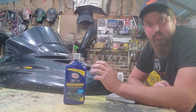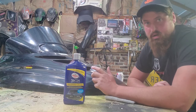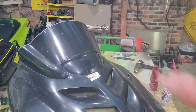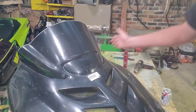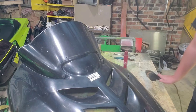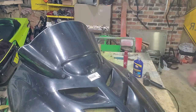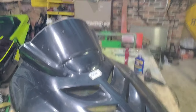With a regular fiberglass hood I would just use a buffing wheel and polish it that way. On this Lexan, it's not very thick, so I plan on just using a regular old rag and compounding with some good old elbow grease. We've got a stubborn trail permit — a Michigan snowmobile permit — that leaves a void sticker behind when you peel it. I hate them. We're going to try it with a heat gun and a blade. If that doesn't work, I have rubber eraser wheels — they're awesome for debadging vehicles and getting 3M double-sided sticky tape off. They're a total lifesaver.